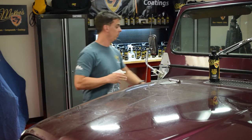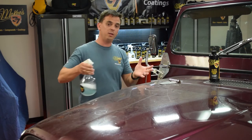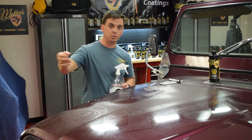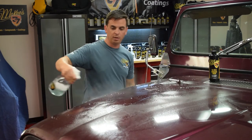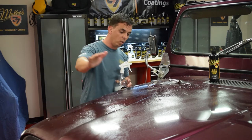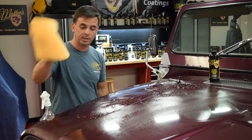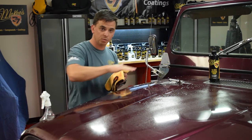When using a waterless wash, you want to have lots of high-quality microfiber towels, and you want to spray a heavy film of product — apply it really wet. The reason you want to do that is lots of lubrication. Normally when you use a spray wax, you just do one or two sprays, but for a waterless wash you really want to have a thick layer of cleaner on there. N914 contains super slippery polymers that encapsulate the dirt so that when you wipe it off, it gets trapped in the pile of the towel and therefore doesn't scratch your paint. Spray it down, take a towel, and wipe in one direction — this is not something you do in a circular motion because you'll scratch the paint.